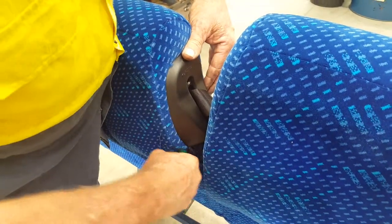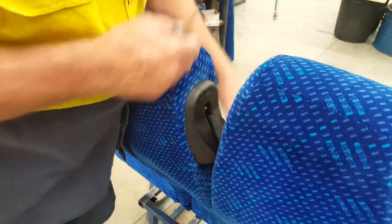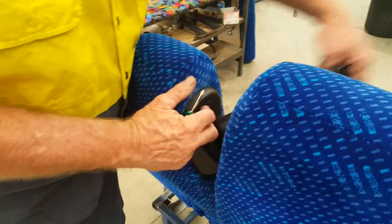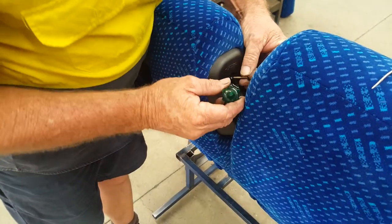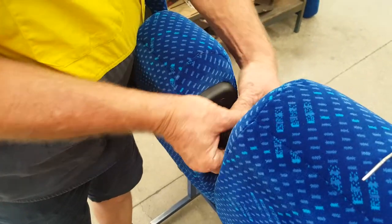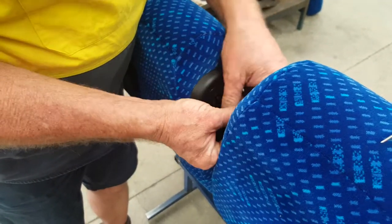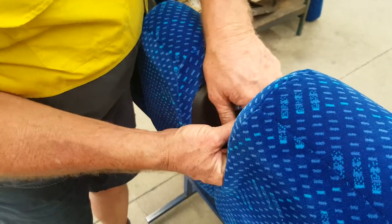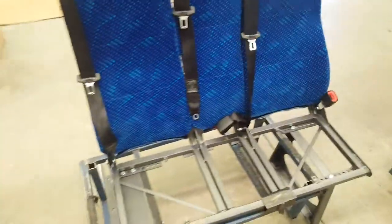At this point we make sure everything around the seatbelt is clean, and the seatbelt is in. Then we put the top screw in, and that's all that we need to do. Ensure the seatbelt is working, and then we insert the screw. You could put a little bit of grease on it to make it a little bit easier, which will help. We're using a screwdriver blade — obviously in the workshop we use a different tool. And there we go, it's in there tight and it's working. So then we'll proceed to mount up the bottom of the belt.